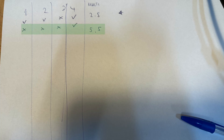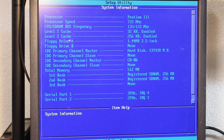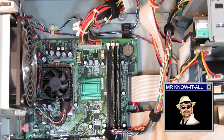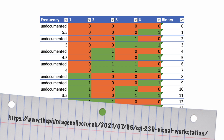So even after changing the jumpers to the correct position for a 5.5x multiplier, the CPU is still recognized as a 733 MHz CPU. So in this perspective, the statement about auto-detection on the mainboard is correct. Maybe you should try disabling the auto-detection — I tried, but there's no jumper or BIOS setting to actually disable this behavior. And as much as I would have liked to document the additional clock multipliers, it seems to be totally superfluous anyway.